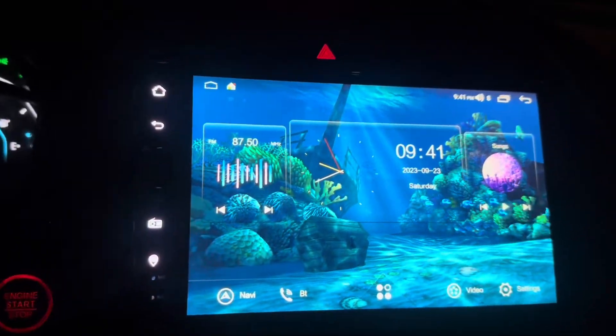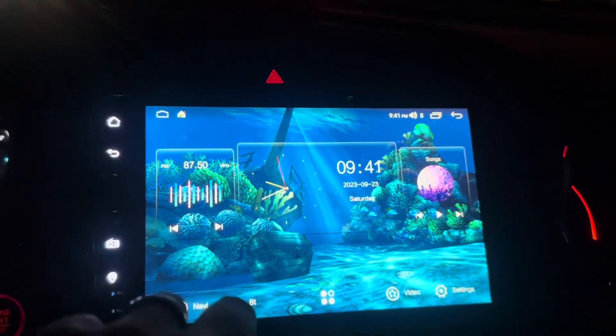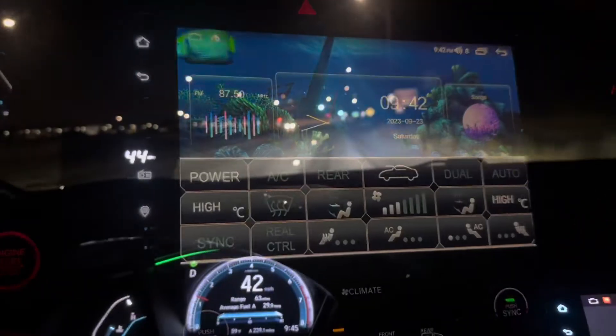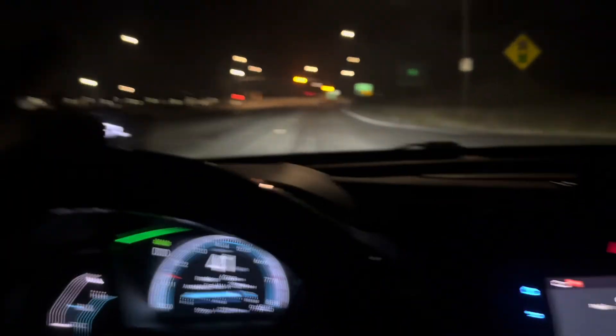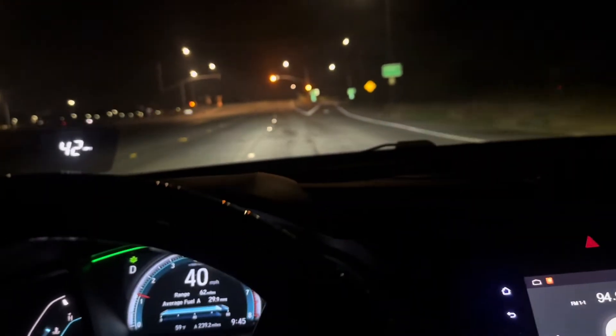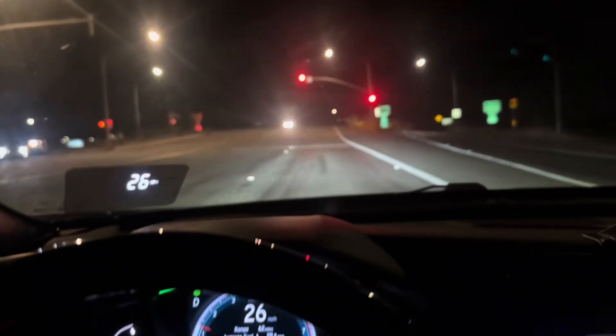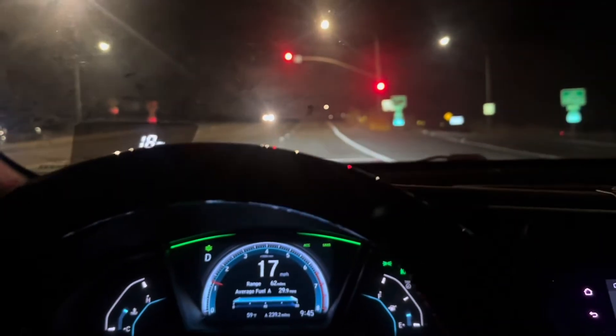It's getting really warm in this car right now, so that's a good sign. Just drive it around normally and run the heat on max with the fan low for a drive cycle or so. Check your coolant levels when the car is cold and top up as necessary.